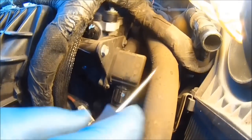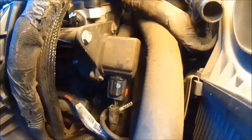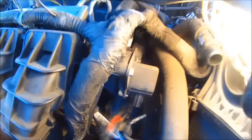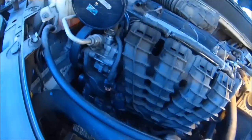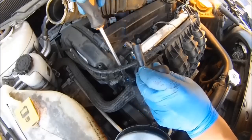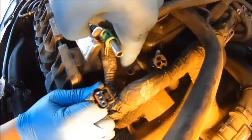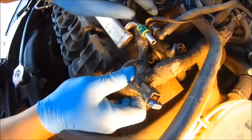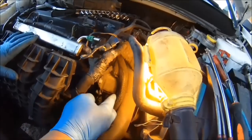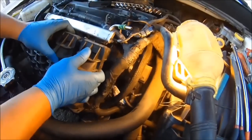Next, take off the connector to the intake manifold runner position sensor. Pull the red tab down right here, just like that. Grab the other tab down here, then wiggle it and pull down. Same thing with this one — the MAP sensor. Next, this connector here — push down on that, just pop it out. Take off this connector to this sensor here. Pop it up. Now start moving everything out of the way — move this hose off to the side so we can get the sensor out.